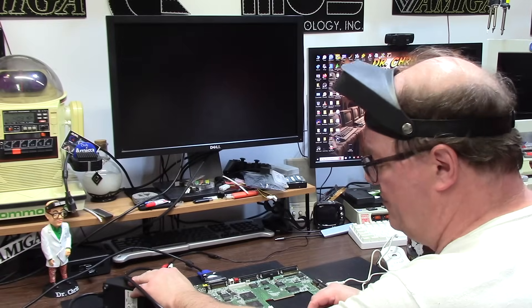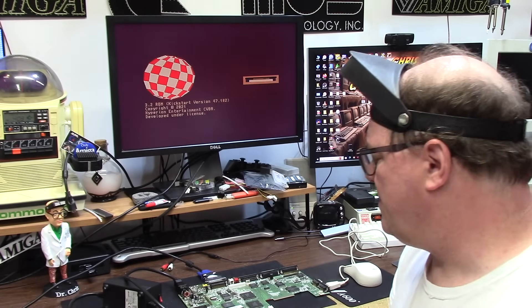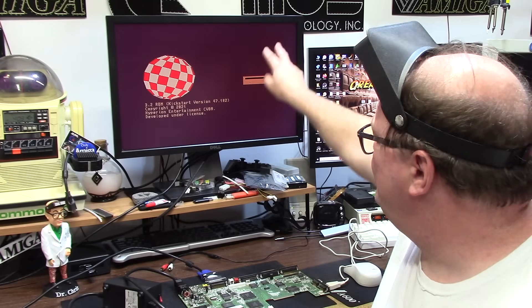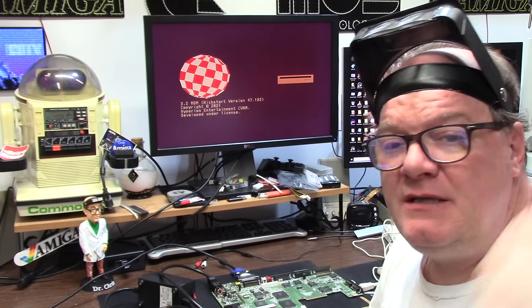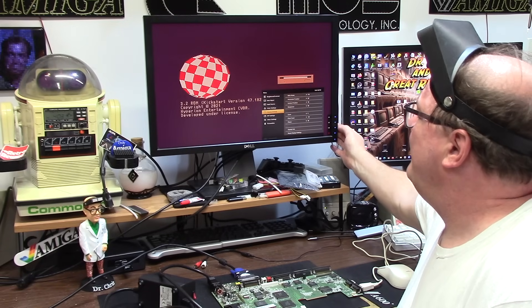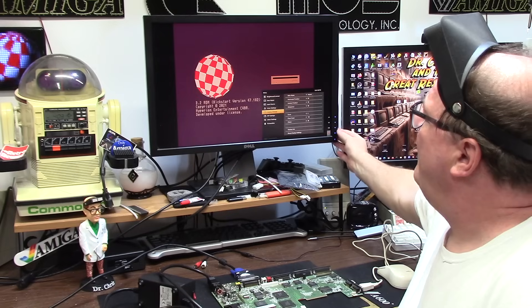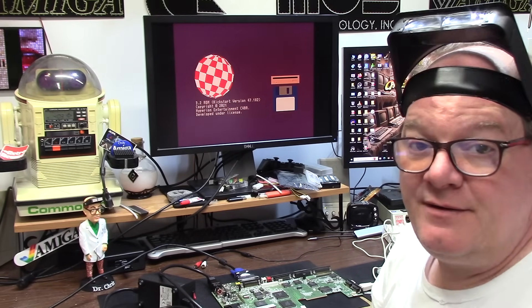Let's see what happens. I have no lights so... 47102, kickstart 3.2.1 — working. My monitor shows raster lines on PAL. It is a 60 hertz monitor, capable of doing PAL like you're seeing here but there are some lines. It actually is supposed to look like this in 4x3. I just have it on fill — that's a little bit clearer but the lines are tighter. You really can't see them on camera. There's a functioning machine as far as it turns on.